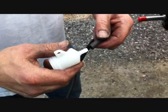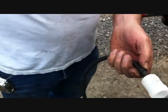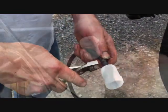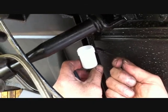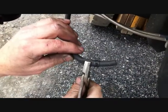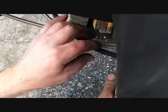Install the reservoir to the hose as shown, then slide the clip up and secure the hose to the reservoir. Secure the reservoir to the frame upright on the top hole of the driver's side with the supplied wire tie. Install your DOT 3 brake fluid — there's a second clamp on the hose, pinched off to keep air out of the system.